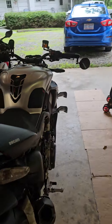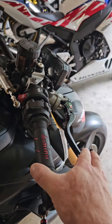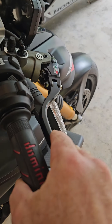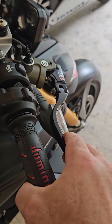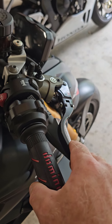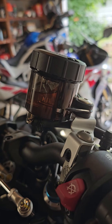I want to go ride this, but this has been bugging me for a while. Watch what happens — check this distance out when I squeeze the front brake. The first pull comes way back, that's squeezing it pretty hard. Look at that gap. And then I let it out and grab it again — and look at that. It firms up on the second pull.